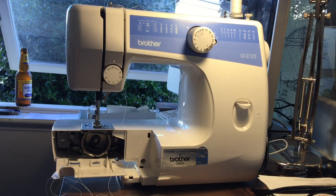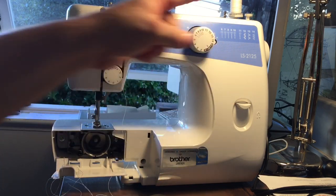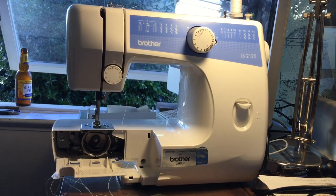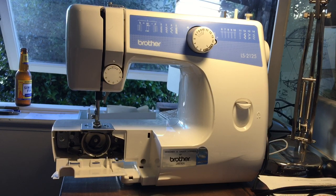All right. Good news is, they are pretty simple machines. There's going to be, in the back, a whole pile of gear-driven drivetrain. And in the back is a belt. Why is that good news, you say? Well, because the belt is the bit that's going to have jumped out of time. And that's what we're going to fix today. Find the screws and try and pull the covers off. Of course, this is the bit where you can break it even further. So make sure you've got your Superman undies on. And let's see what we can see.